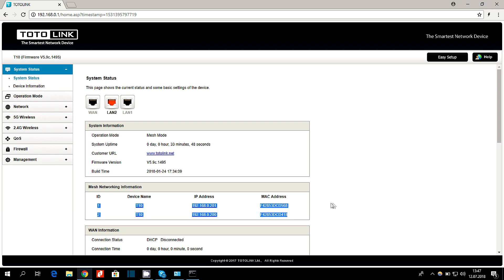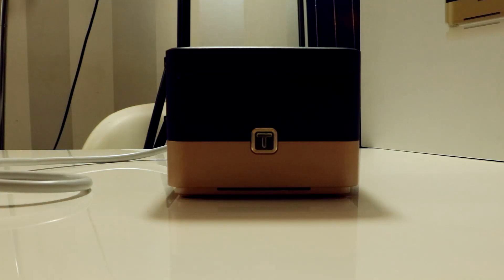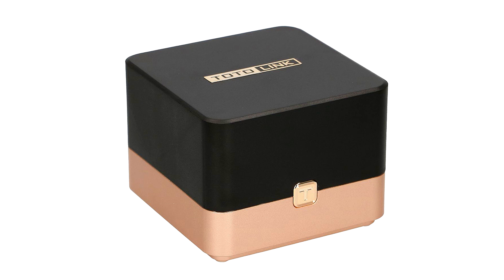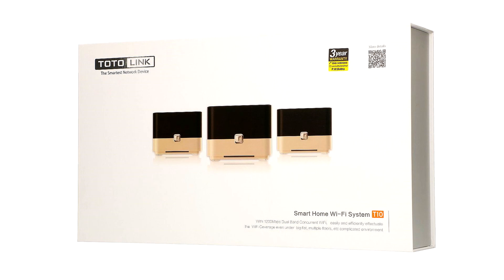This network can also be created in a different way. After connecting your devices to electrical outlets and connecting your main router with a LAN cable to a computer, just click the button on the main device and hold it for about three seconds until you notice flashing orange and red again. After this, the process looks the same. As you've probably noticed, it's very easy. I also invite you to see the T10 test results available at our website — a link is given in the description and on our forum. Thank you all for watching, subscribe to our channel, and see you again.